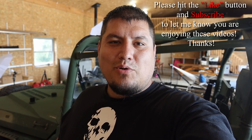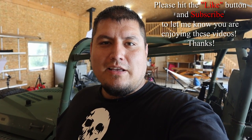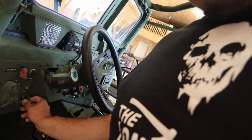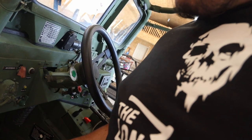So yesterday I posted a video, and at the end I was talking about a problem I was having with the turn signal. And so that problem actually leads into today's problem. After that video, I came back this morning to check out the growler and move it, and the starter was in this position, the run position. That's kind of like having the car with the keys in it and turned on with the radio on. So the car itself was not running, but the accessories were available to be used. Same thing with this, and that led to a dead battery.